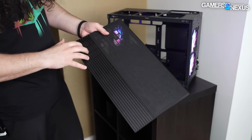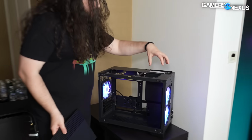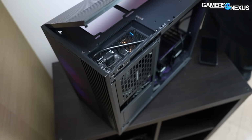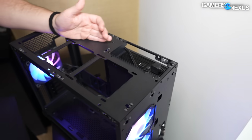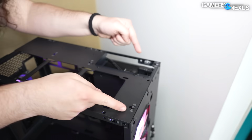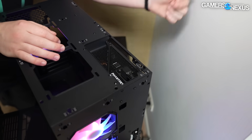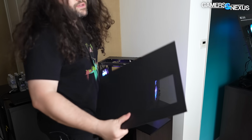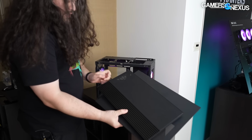This is very low ventilation, it's low porosity, but the power supply ends up mounted up in the front on the side, so it's offset from the fans, which is supposed to get out of the way of the fans. Some of these smaller box cases or medium-sized boxes will block the top slot with the power supply if it's rotated that way. So they've shoved it over. The exhaust ends up kicking out here, intakes through the side. The side panel does have punch outs in it, so that's ventilation for the power supply intake, and then the exhaust for it ends up coming out here.